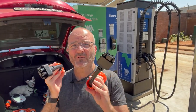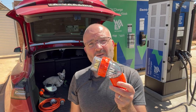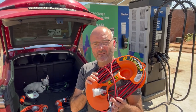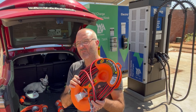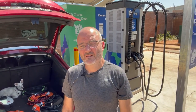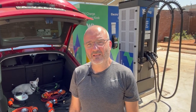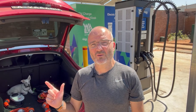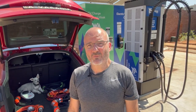I also bought two additional tails from third parties for the Tesla UMC, which allow me to use three-phase charging sockets fairly common in campgrounds and industrial settings. We also have a really long extension lead — not recommended, but sometimes the power point at an Airbnb is further away than the charger cable reaches. If charging through an extension lead, feel the cable and if it's getting hot you can dial down the amperage in the car or the app. The standard is 10 amps but you can dial it down to 8 or 7 amps, which will slow your charging rate.